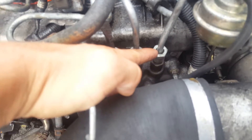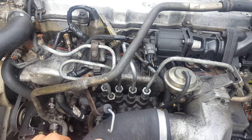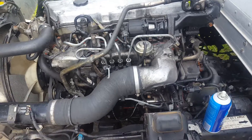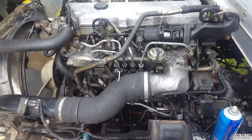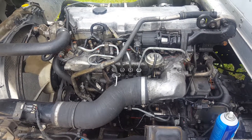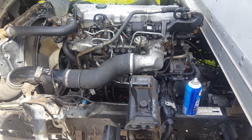When I tested the fourth cylinder injector — this one — I put my cap on it and left the other three hooked up. I attempted to start it, and it started right up without starting fluid. That confirmed my suspicion of there being one or more bad fuel injectors, because the injector was not allowing enough fuel pressure to build to start the engine.